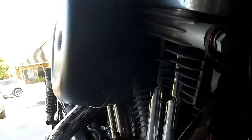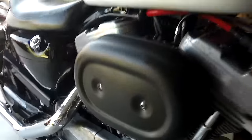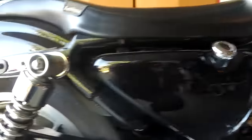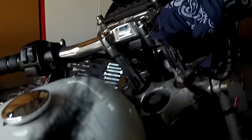The final verdict is that the bike is 100% more responsive than it ever has been, and I'm pretty sure this has been an issue a lot longer than I've actually had the visible leak. If you know your carb's pretty clean and you've run cleaner through it, but you can't seem to find a problem and gasoline pops up where I was showing you, then you would definitely want to change that accelerator pump diaphragm.